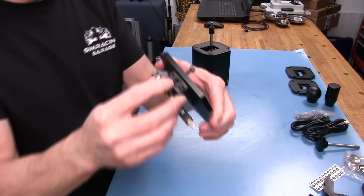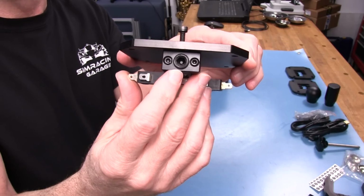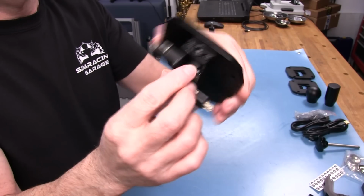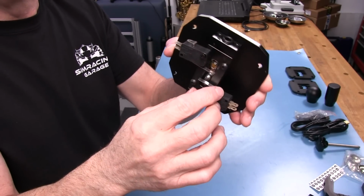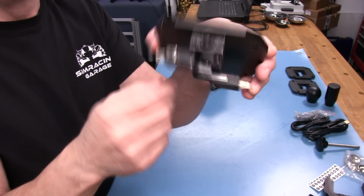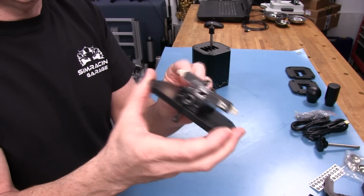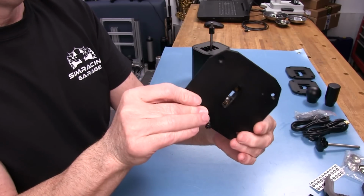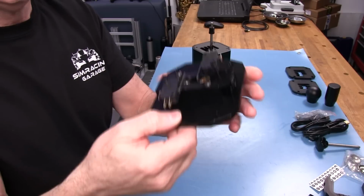Yeah, we have some tensioners on each side of those ball bearings, so we can make it harder or softer to do our shifting. And of course, it doesn't matter as far as the switches go, as far as the tension is concerned, because these ball bearings and the springs are taking it. So it's kind of a preload, if you will. Again, a nice thick plate, about 4 millimeters thick, I imagine. Looks about 4, doesn't look 5.